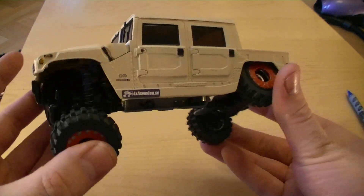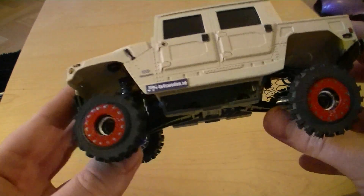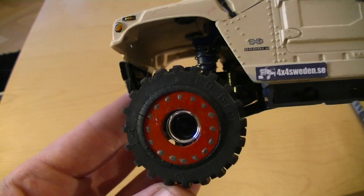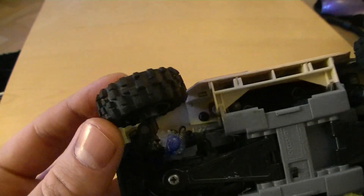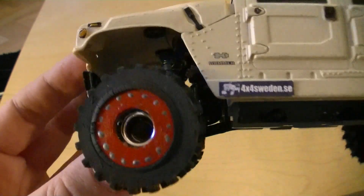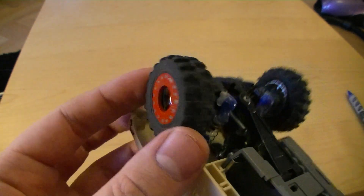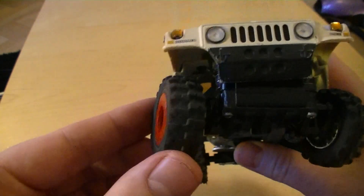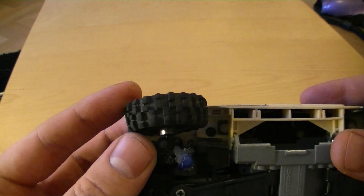It's kind of flexy. The tires are Lego tires, 30.4x14, and they are custom-siped to soften them up a bit. The rims are regular racer rims, the offset ones, but they are kind of narrow, so I added a washer to act as a simulated beadlock to widen it up a bit. It works really good — these tires are really grippy.